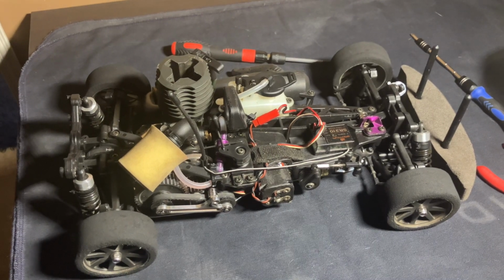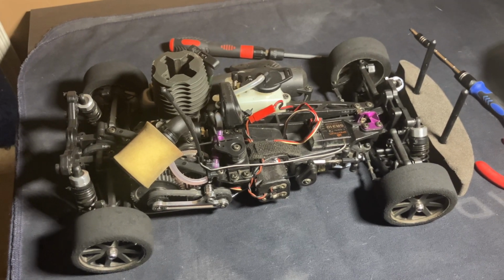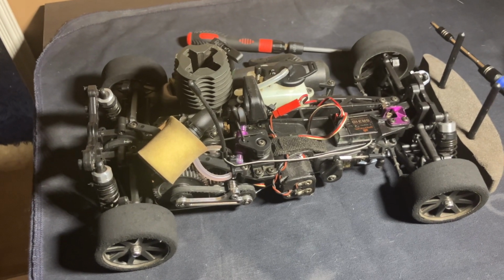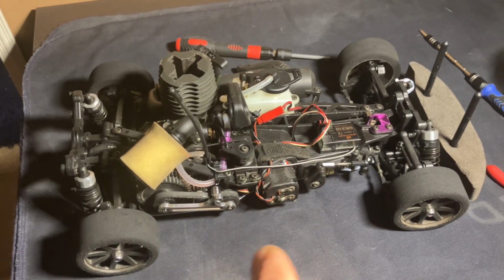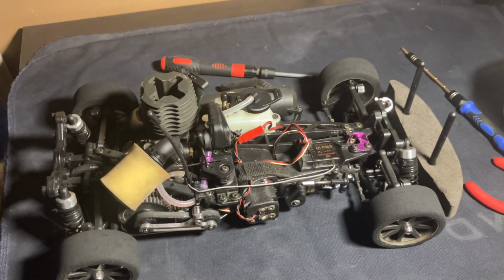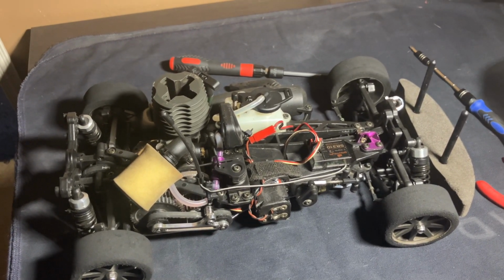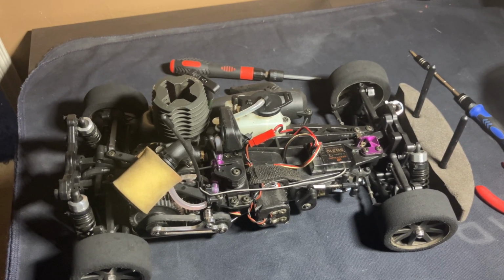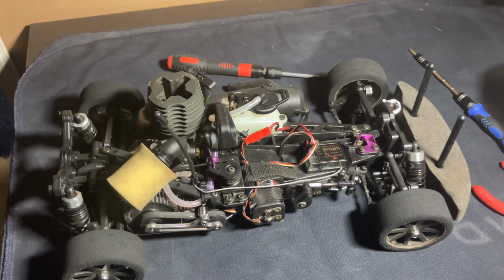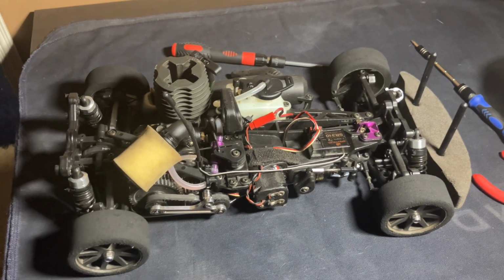And I don't know if I said, but the issues on my RS4 3, I think, are due to the servos, because the servos that died in here are the same type of servos I used in that vehicle. So I blamed it on the outdated throttle linkage and all that, but it wasn't that in general. It was actually the servo. The servo was just erratic and it wasn't performing as it was supposed to, and I didn't take note of that, and that's the reason I feel like the RS4 3 is now totaled. But you know, you live, you learn, you buy quality parts, and you shouldn't have any issues no matter the age of your vehicle. Have fun, guys.